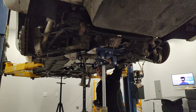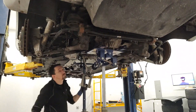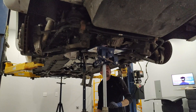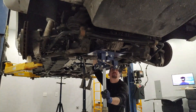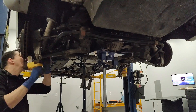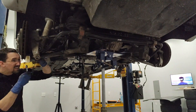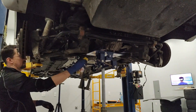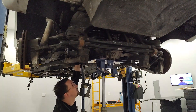Let's talk about the actual purpose for this. I want to use this transmission, and that might seem a little weird, but like I was talking about in the previous video, I want to use the transmission because it's going to put some of that weight over the back of the axle, which will help with weight distribution. I'm probably going to be a little nose heavy in the final build, but my goal is to get it as close to 50/50 weight distribution as possible. That's why I'm going through and removing this transmission to use it for the Toyerati build.